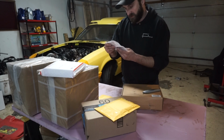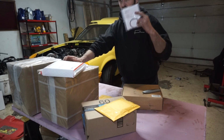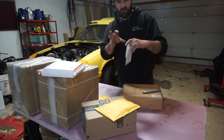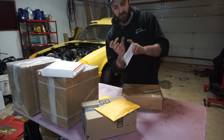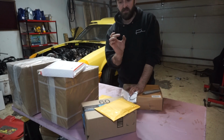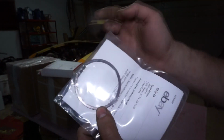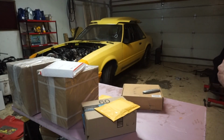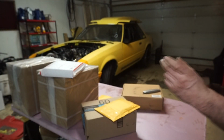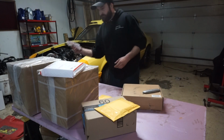Nope, this is a spiral lock. So it's the spiral lock for, I forget off the top of my head which drum it is, but there's a Sprague lock, there's a plate, and then it comes with like a snap ring, and if you spin it at high RPM, it will separate the snap ring. So this is like a spiral lock snap ring, and it wraps completely around, and yeah, so it's a spiral lock. And like the 4L80s have them, but the TH400s have the snap ring, and if you spin them fast, they can separate, and then you lose one of your Spragues.